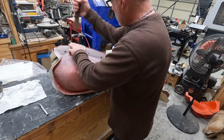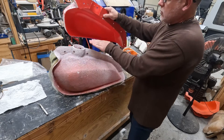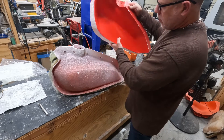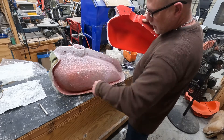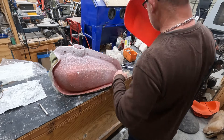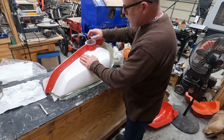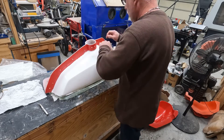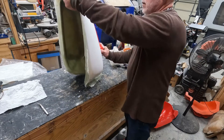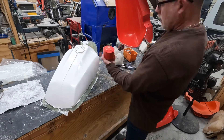As you see, it comes around fairly well. I tend to try to peel my molds away from the center line so that I don't break or chip the edge where the gel coat is meeting right here. I try to keep it so I don't chip the gel coat. And then sometimes it needs a little push. Voila — there's our parts.